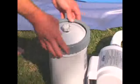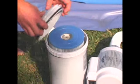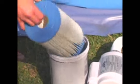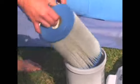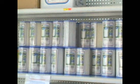Remove the filter top collar with a counter-clockwise rotation, taking the top and the filter cover off, then lift the cartridge out. If your cartridge is dirty or brown in color, try spraying it clean with water. If it cannot be rinsed off easily, the filter should be replaced.